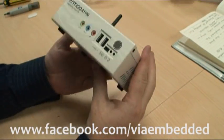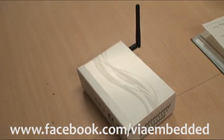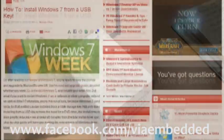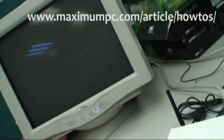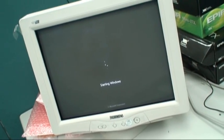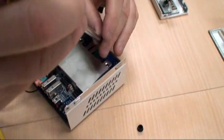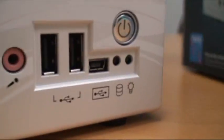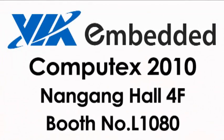And here it is — complete with wireless module, SD card reader, and of course our SSD solid state hard drive. Now I'm going to load Windows 7. Thanks to Maximum PC, you can learn how to put Windows 7 onto a USB stick. This is my 8GB stick here — I'm just going to attach it, and it will automatically boot from USB because it doesn't find an operating system anywhere else. You'll be up and running with Windows 7 in a matter of minutes. I'll see you next time.